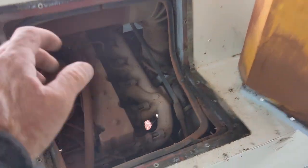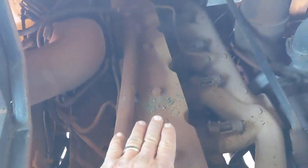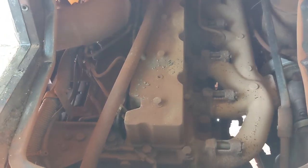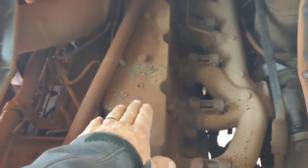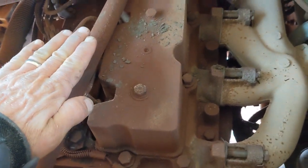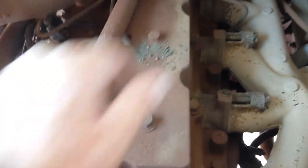With that panel in place, you would not be able to lift up the valve cover enough. Right now we could take the bolts out, take the valve cover off, do a valve adjustment, things like that. If this panel is covered up permanently in a way that you can't get in there later, you're going to end up ripping out your bed if you ever need engine work done, or you're going to pay a ton of extra money to have the whole thing dropped out from the bottom. Instead of just removing the valve cover from the top, you'd basically have to remove the engine just because there's a double layer here — there's just no way to lift the valve cover up enough to pull it out and clear that.